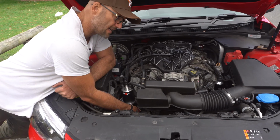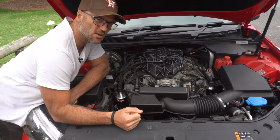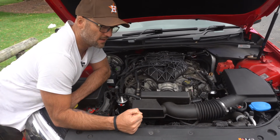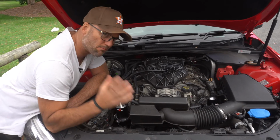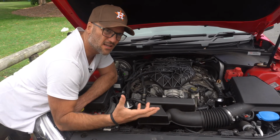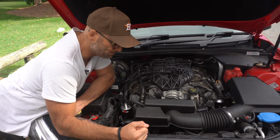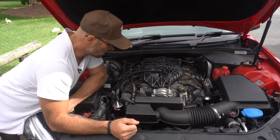So it's quite a fascinating system. The ventilation and vacuum pressures of a motor as it's operating. It's quite a bit more complicated than I imagined. Hopefully this system is taking care of it and cleaning that blow-by that happens as the compression stroke forces air down past the piston, and of course all those particulates are going to be filtered out by these cans.